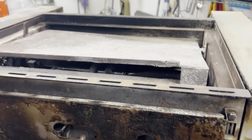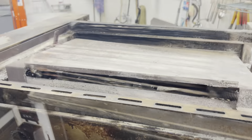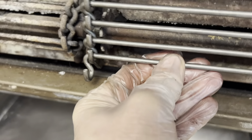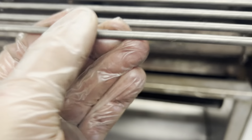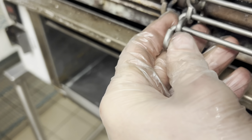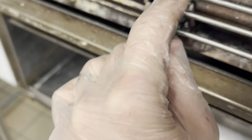So that's problem number 18 on this unit. Take a look at the existing chain and how it's hung. It's hung this way — only one end of these chains has a master link that's open, the other end is closed. It's a real pain, but we're going to either go to the other side and feed it in, or unroll it and feed that end in. We want it pulling this way; we don't want it inverted where the links are facing down — facing up matters.